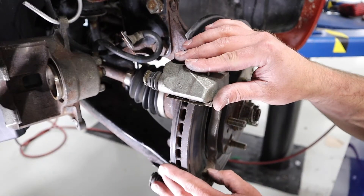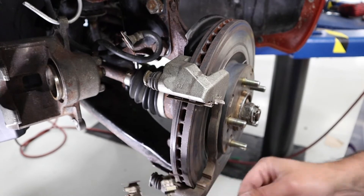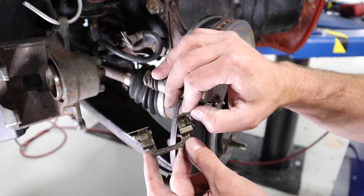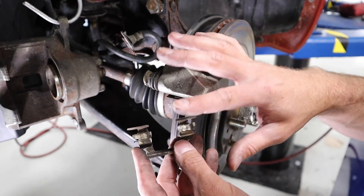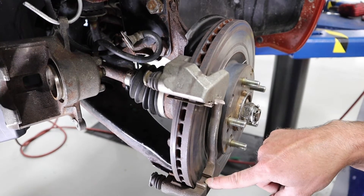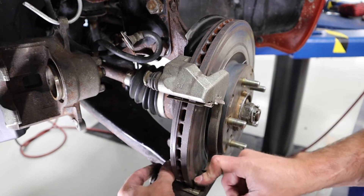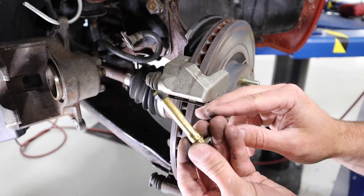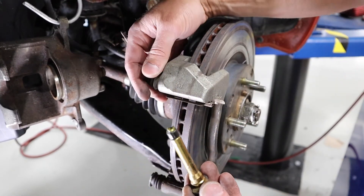Back at the car, I want to look at a couple things with my brake caliper bracket. If I'm doing a pad change, I'll typically get some small consumable items as part of my brake pad set. If I don't have new ones and I'm going to reuse them, I want to make sure they're clean and lubricated. One of the better ways to clean these components is a small wire brush. I also want to make sure the bracket area is clean, as it's prone to buildup and corrosion. I also want to take special care to look at my guide pin bolts — they're typically different top versus bottom — and make sure they're clean and well lubricated, with dust boots in good shape.